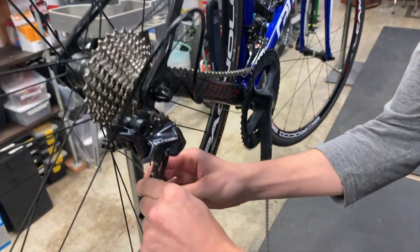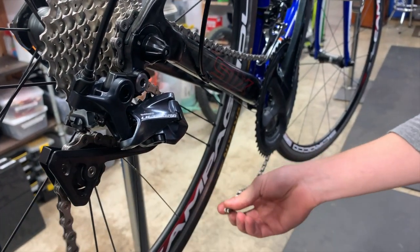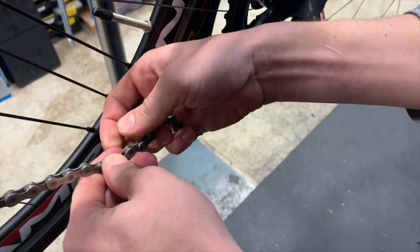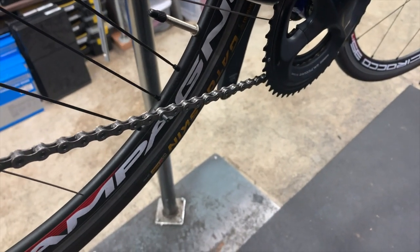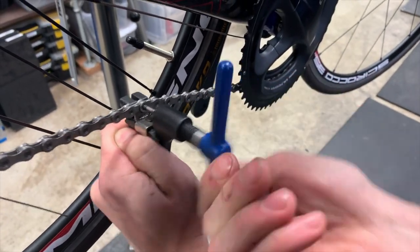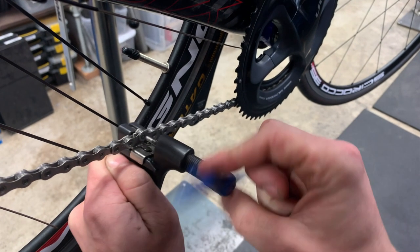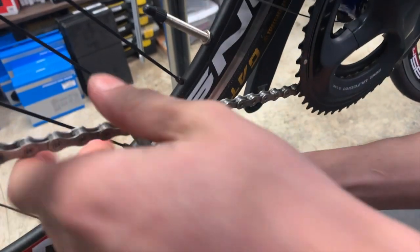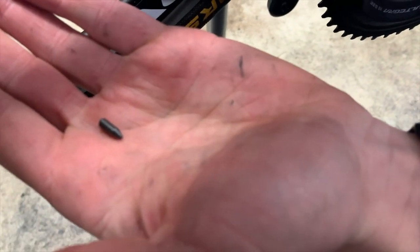I'll go ahead and run it through the derailleur. I've got it in the low gear up front so there's the least amount of tension on the chain itself — that makes it pretty easy to stretch it and connect it. I've got my pin in my hand. This can be a little tricky since these chains are pre-lubricated from the factory. You'll want to slide that pin in, hold it together, grab your chain tool, and push it in. It is really important to wait and feel for that second pop — that's when it's into place. It's pretty subtle on most chains. Then take a set of pliers or a chain breaker tool and break that pin tab off. You do not want that running through your derailleur.